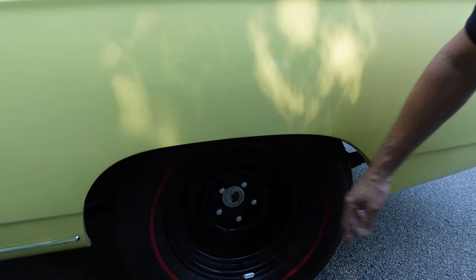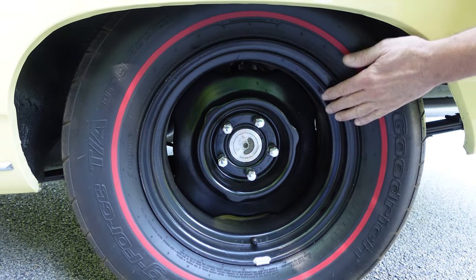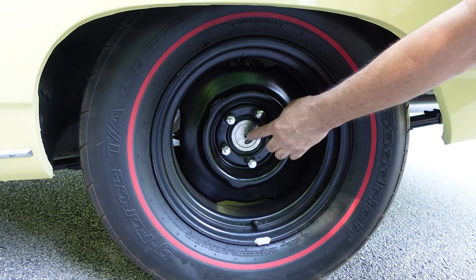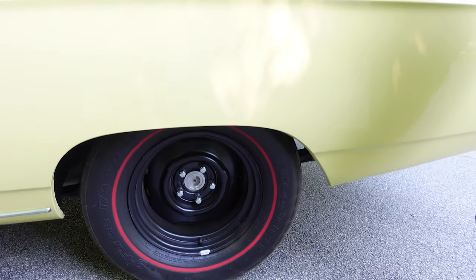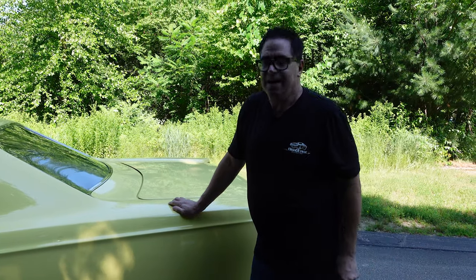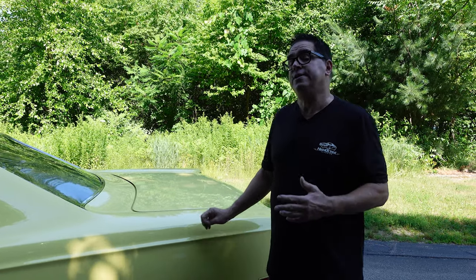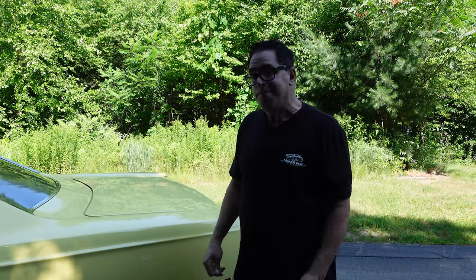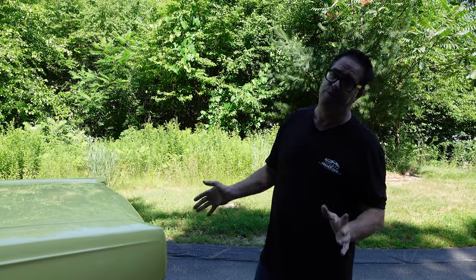And getting back to the wheels, at the rear, it has 15 by 8 Chrysler wheels as found on Ram Chargers and Super Coupes of the mid-1970s, but again, the correct chrome lug nuts. Now, the rear axle on this is an aftermarket Dana 60 with a 9 3/4 inch ring gear, so that 4-speed and that 451 wedge are not going to harm it. And also, the Dana rear axle was standard equipment in all A12 69.5 6-pack and 6-barrel B-bodies, so all the right stuff is here. Again, it's a nicely done tribute, a clone, we would call it.